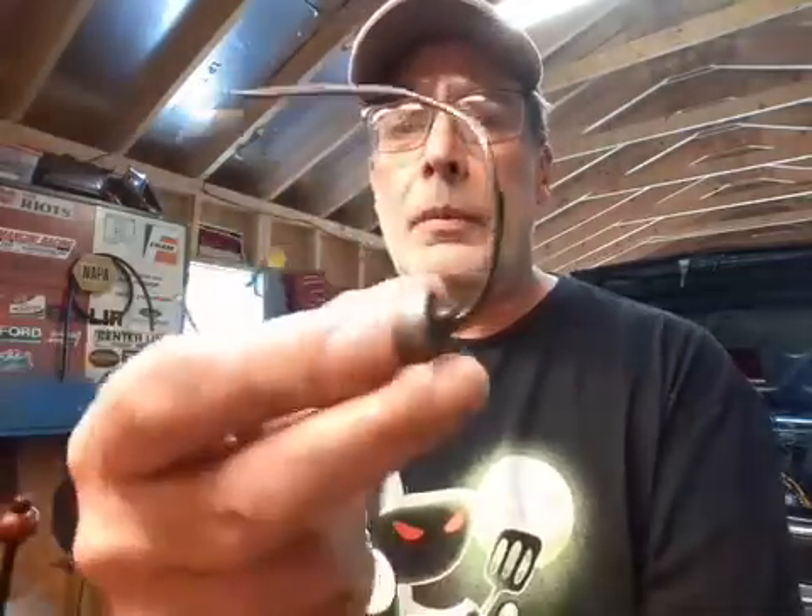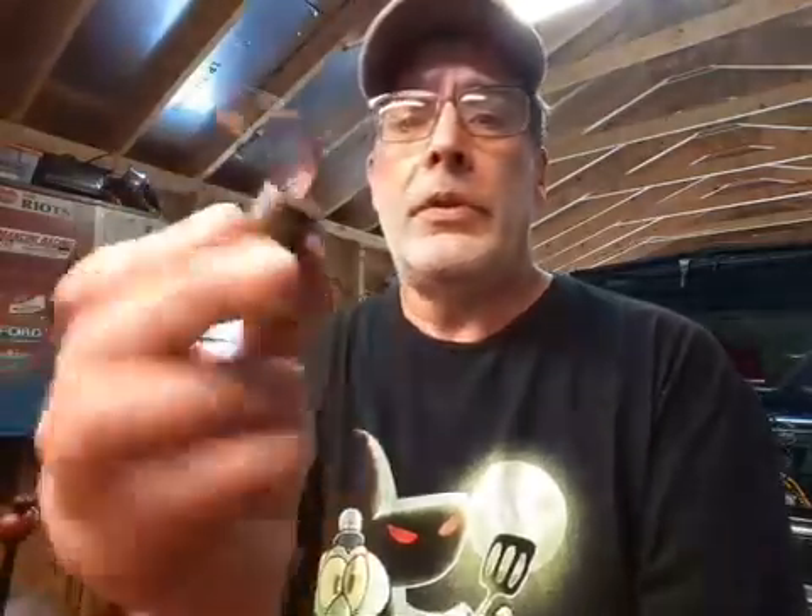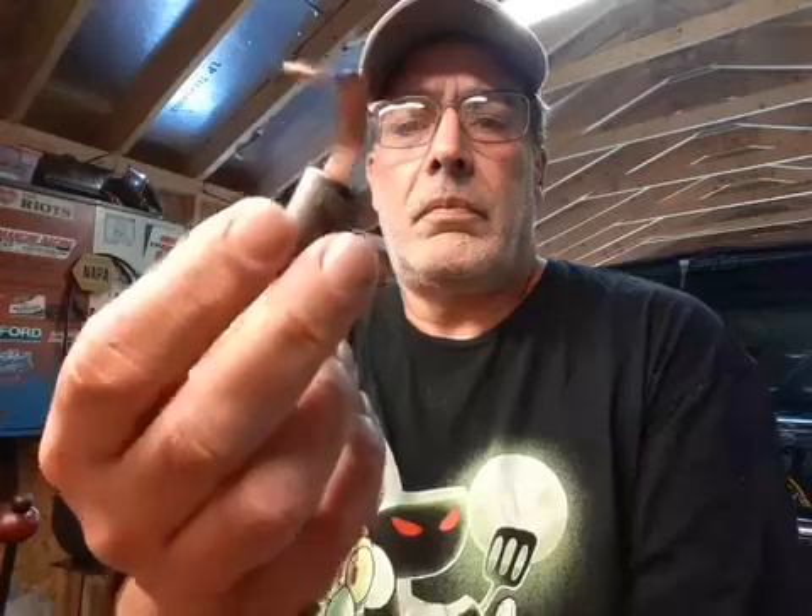I just tested this old one for a dual point, and this one from a radio suppressor that goes on a coil — they're all good. They're probably 50 years old. This one here could be 20, 30, 40 years old. I don't know, but they're all good. Same thing — it's a good condenser. Your meter will tell you if they're good or not. It's really simple.